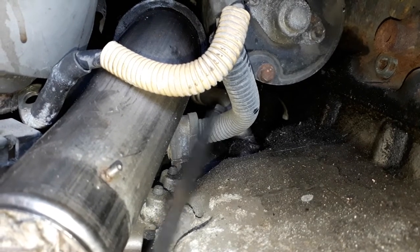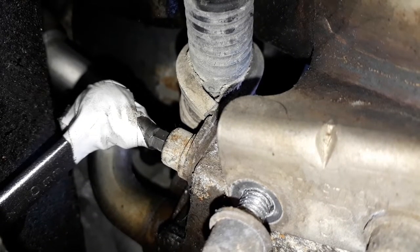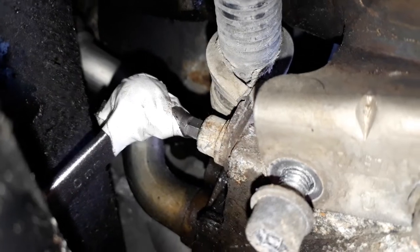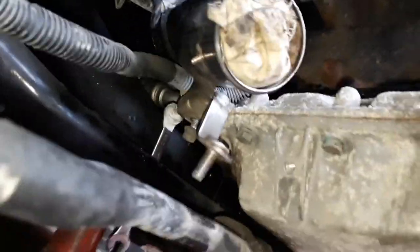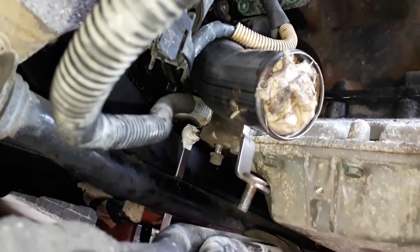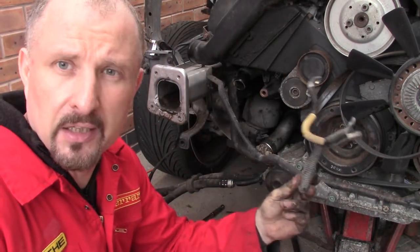To get this hose clamp off so I can remove this cable, I've got to undo this allen bolt underneath the sump - just where the tip of my screwdriver is. Actually, it's a bolt behind that bolt I pointed to with my screwdriver and you can't get to it. It's insane. I don't know what Audi was thinking but oh my god this is a pain to get to. I've had to make a special tool with a spanner and an allen bolt tool bit and some tape. Hopefully I can undo it. Well, I'm not going to tell you how long that took, but this rubber clip is finally off and this loom is finally removed from the engine. Audi, what were you thinking?